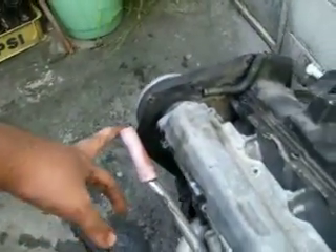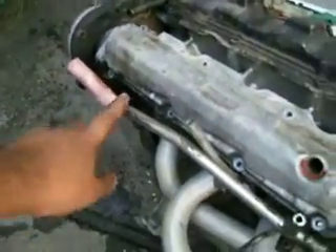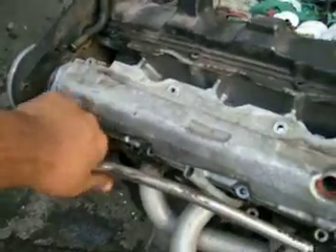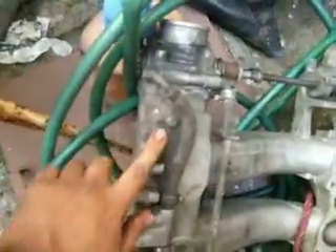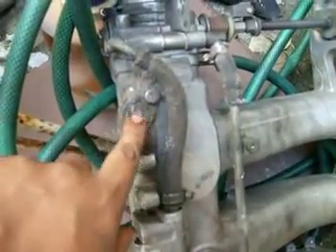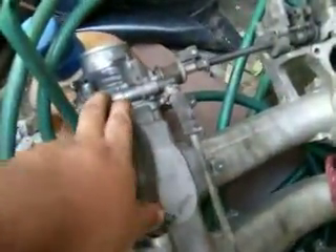What I did with my old engine while it was still inside is I cut these tubes, then I put a piece of hose and stuck a bolt in there, held with two clamps. Under the plenum you're going to need some plates that I cut and did a little welding — you can see there's a little spot that's been welded. Then you just put some silicone on it and cap this side of the plenum.